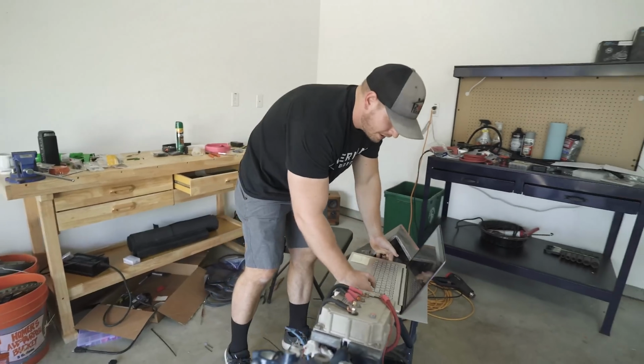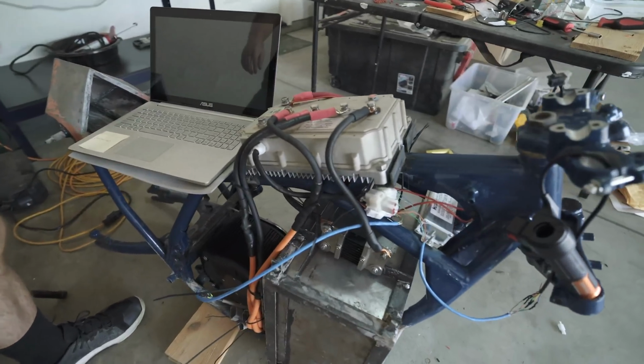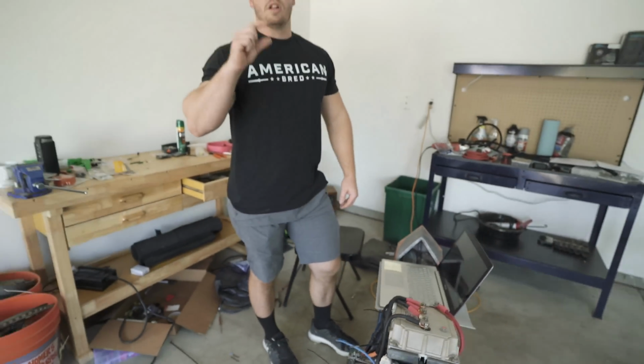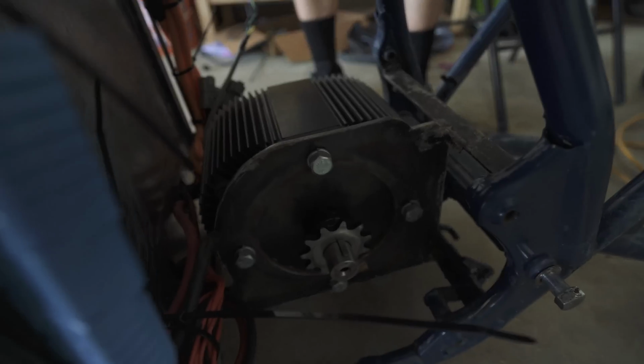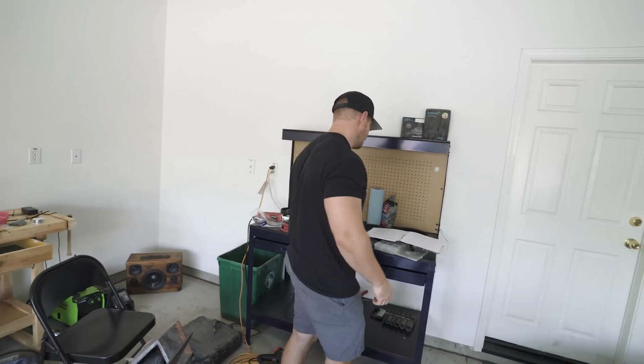Not yet. This motor is different and this controller is different because it's sine cosine. With the Hall sensor one, you plug it in, you run an auto identification angle, and it's ready to program. This one you have to actually figure out some of the Hall line parameters. So what you do is you run a program, turn the motor a couple of times, and this is all outlined in the manual I printed out on the side there. You turn the motor manually, and then it registers the high and the low Hall effect measurements, and then you can input those into the program when you start programming. Otherwise, it's not going to be able to effectively switch between the poles in the motor, and it won't get any power out of it. So it's got to know what those parameters are.